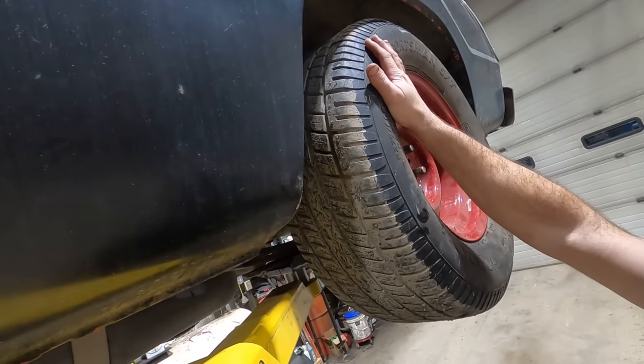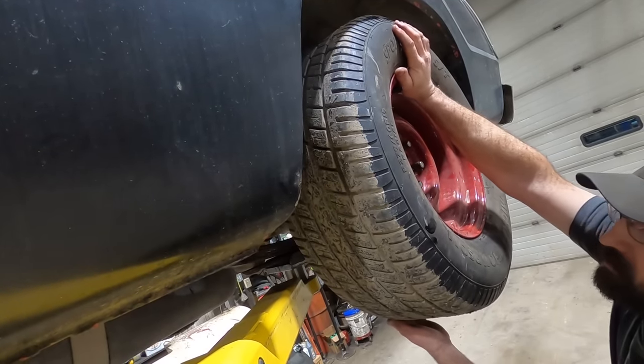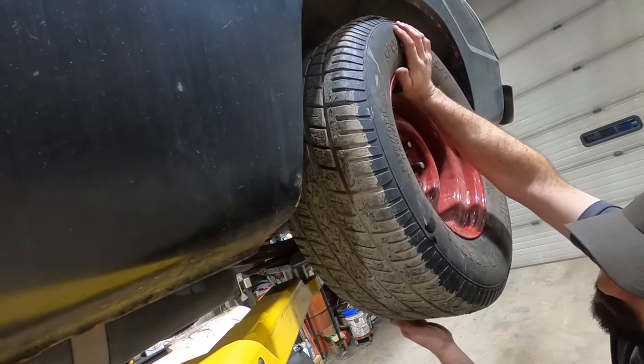I'm not saying this is how it should sound, but it's much better. Barely any movement. So that's 2 weeks in a row. Exhaust. Last week, the brakes were absolutely terrible on the '84 Chevy 1-ton, and the guy had drilled holes in the mufflers. So I'm wondering if the exhaust overpowered the sound that the caliper was making, dragging against the rotor.